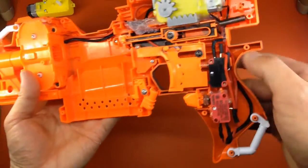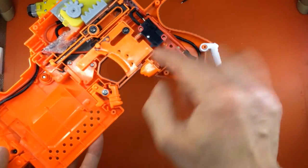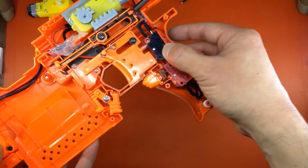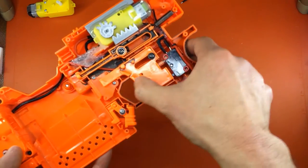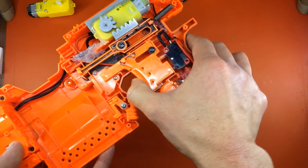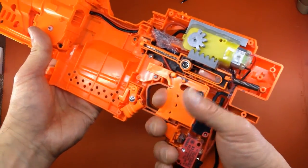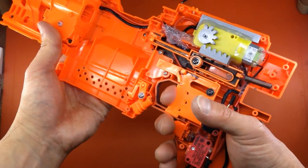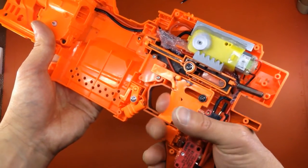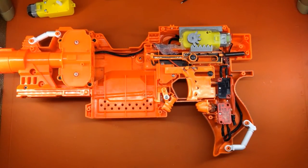In terms of fitting the switches, this kind of configuration is nothing really new. If you take a close look, you can see that the stock trigger directly engages the microswitch button — no lever required. The travel is very short, which can be considered a plus or a negative depending on your preferences, but it does allow for pretty decent trigger control.